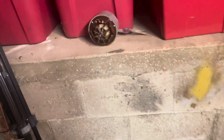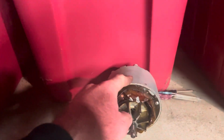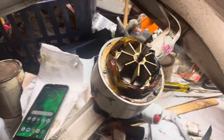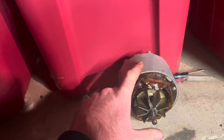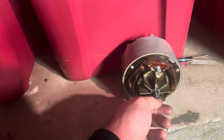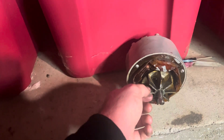This was the motor out of the diffuser grill, and I put it in this box fan. But it was causing problems because this one has a really loud cyclic hum, and this rotor is actually broken — this shaft will actually move in and out of the rotor.